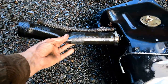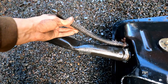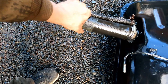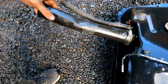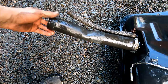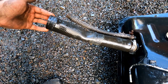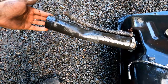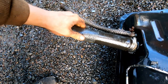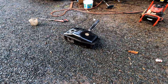Other things to check: is the filler neck in good shape, is the vent hose in good shape? This seems to be the original vent hose. I'd have a hard time believing this is the original filler neck. I did one of these recently on an old second-gen Econoline van, and a piece about 14 to 16 inches long was like $50 for the filler hose. So if you can salvage it, definitely do that. We're also going to blow out the lines.